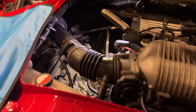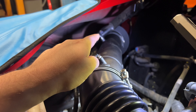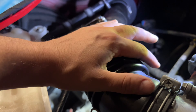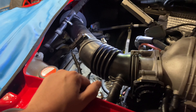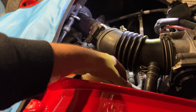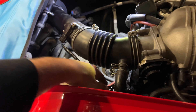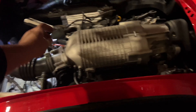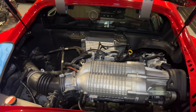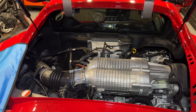After a little bit of persuasion pushing it in, it's actually not that hard guys. Put that end in first, get that clip on, line it all up, MAF sensor connected, back to the throttle body — make sure that one's tight, make sure that one's tight. Ten mil, seven mil, and an eight mil I think I've used all the way through, although you could just use a screwdriver. That's all connected back up now. Originally there was a cable tie around that so I'll probably put one back on there.